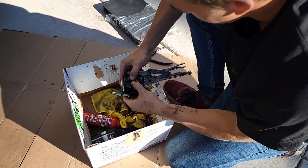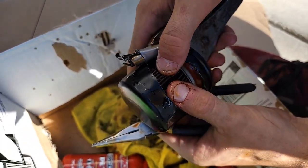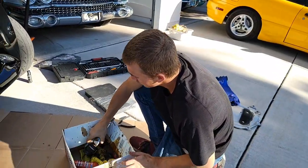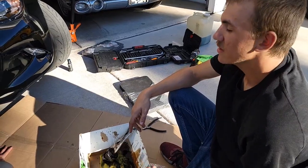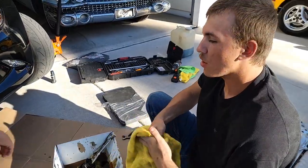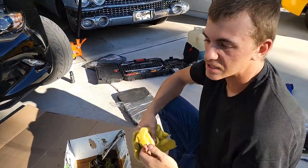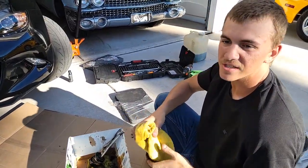And basically what I am looking for is within these cracks, crevices, is where any debris, metal shavings and all that will collect. So the reason I tear these filters apart is to analyze how much wear I'm getting on my internals on my engine. So we'll say bearings, camshaft, housings, all that. All those shavings that get worn off from there are gonna be transported into that filter. So the more wear that I find within the filter, the less healthy the engine's doing. So I always recommend checking that filter just to make sure your engine's healthy.